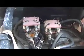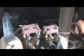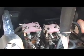I just have these run in series for 48 volts. And if you look back behind the seats, here's a small gel cell battery I added for the 12 volt system. And behind it, this is a Curtis controller — a Curtis 1221B, 48 to 80 volt controller, 550 amp peak. Back here, these are contactors for main power, and that one goes forwards and reverse. So if I flip the forwards and reverse switch — there's forwards, and there's reverse.